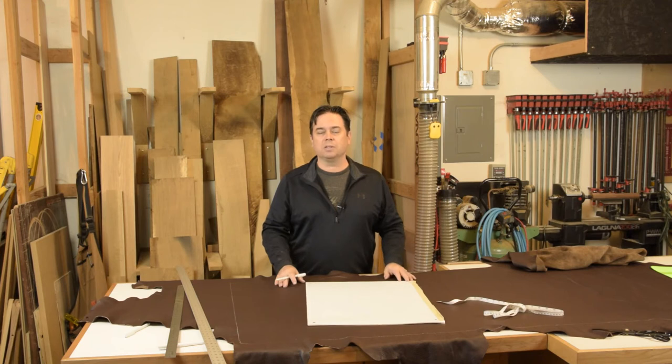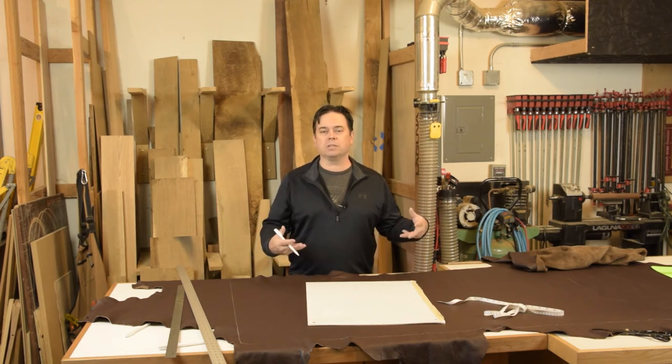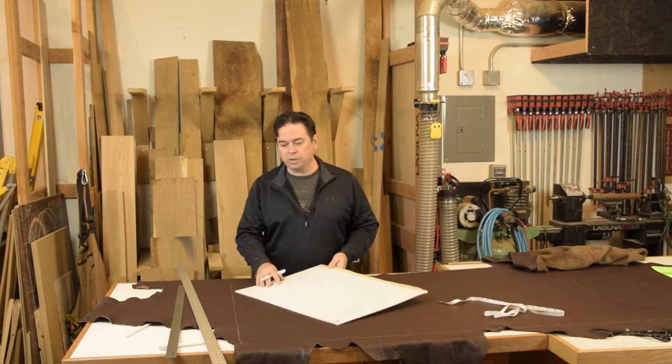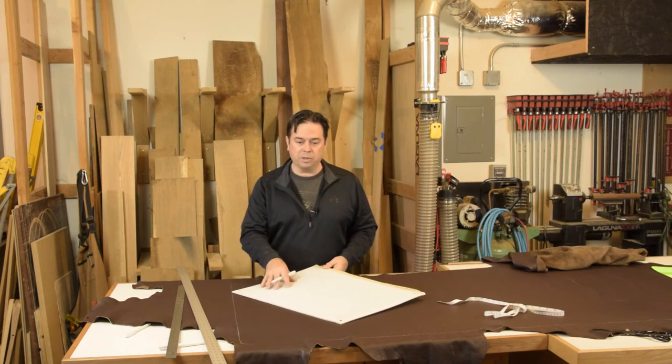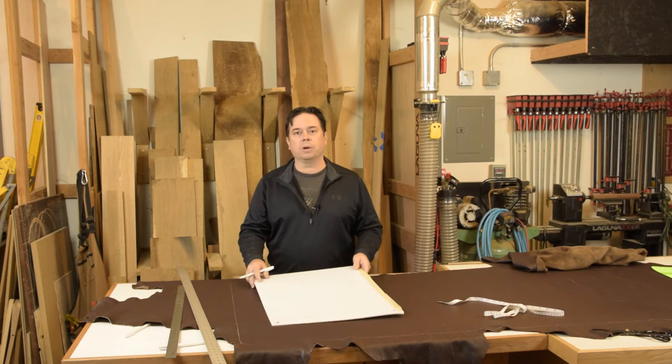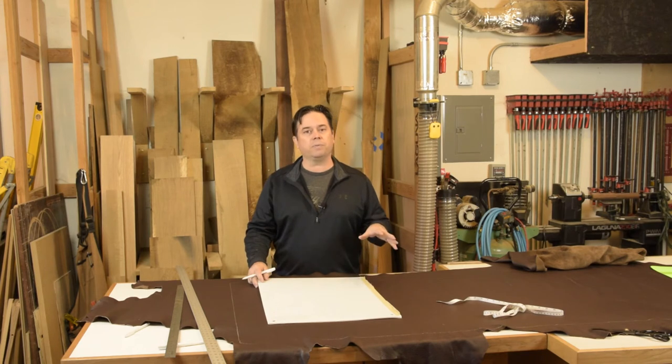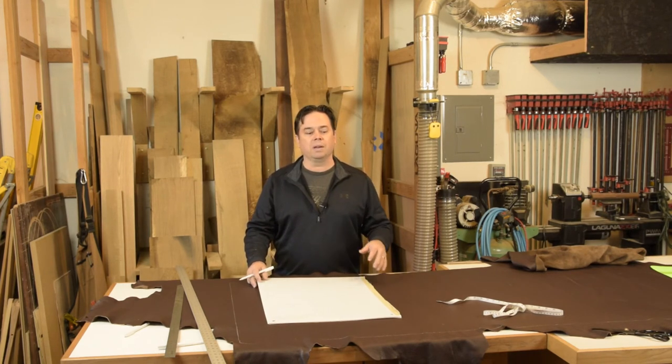This leather panel is so large, we had to roll 2 carts together and make kind of a mega station, but I wanted to share one quick tip that I have learned to use time and time again. When I first started in leather upholstery, I used to pattern everything. Every piece would get a poster board template, and it's great for the side panels that have a shape or something special about them, but on these large panels, there's really no need to template it.